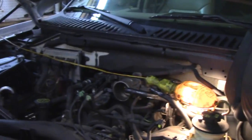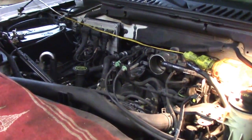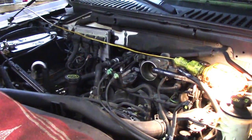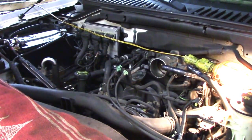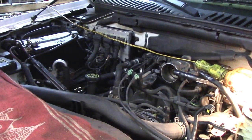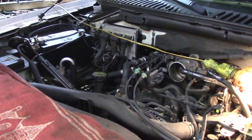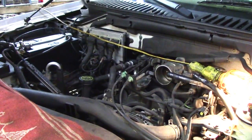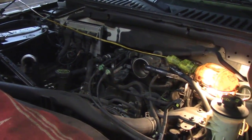We're going to switch coils. To find a misfire without a bunch of fancy tools, the easiest way is to just swap coil packs around. If you swap the coil pack with another cylinder and the check engine light doesn't move and you still have the misfire on the original cylinder, then swap the spark plug with yet another cylinder — not the same one you used for the coil pack. That way if it moves, you'll know whether it was the coil pack or the plug.